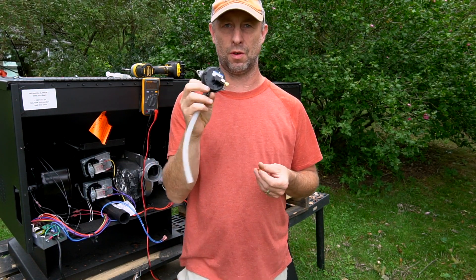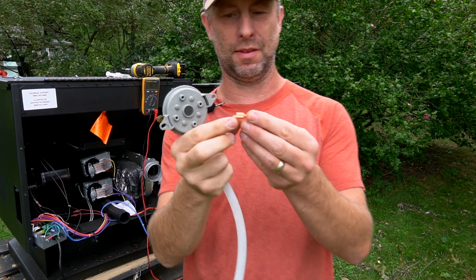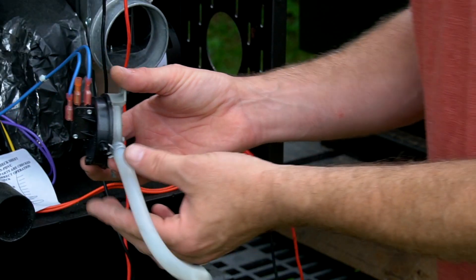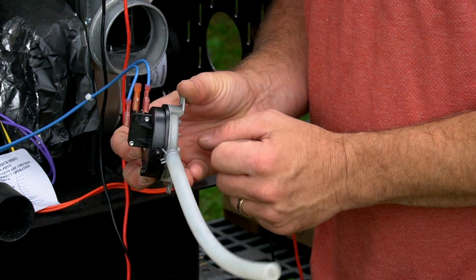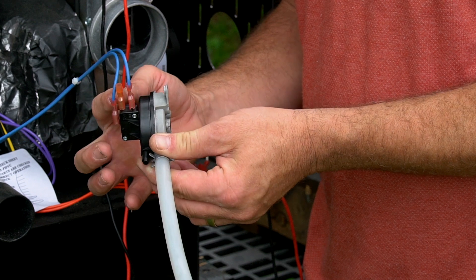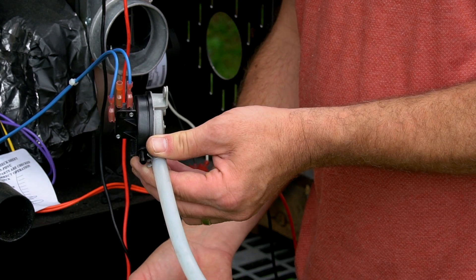When I have this switch in someone's stove I carry around wire disconnects — here's an empty one. See how I put an empty spade on there? That protects anyone from touching that pin accidentally. It also serves as a good reminder that if you're not used to doing this every day, no wire is supposed to go on that middle pin.